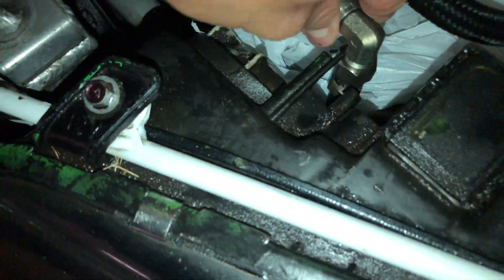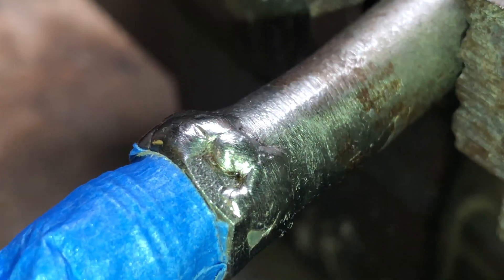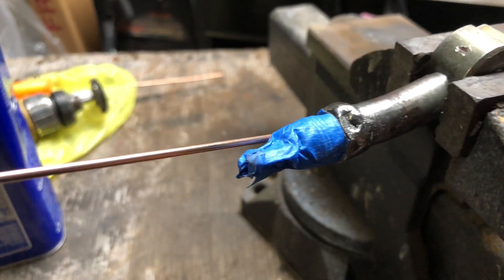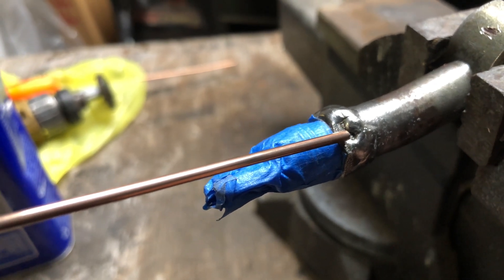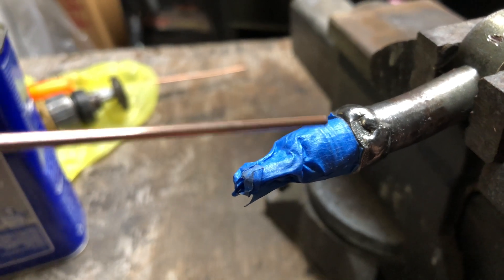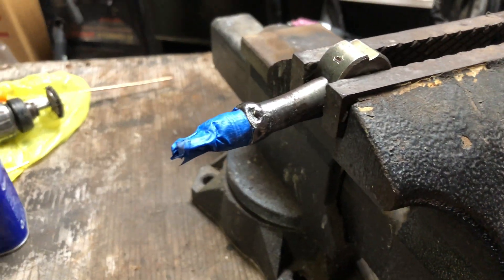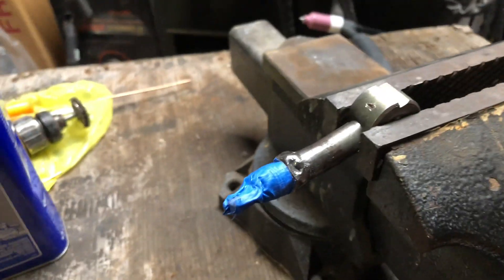All the fluid sprayed all over. I thought it was the little cooler I have. Turned on the car but nothing was leaking from the fittings. I may replace that Teflon tape with the glue I have. For this process, I'm going to TIG weld this fitting. I did find the hole — very, very tiny, right on that edge. Little tiny hole and it was bleeding out. I'm going to TIG weld it with some ER70S6 filler wire. This is for the power steering upper hose that connects to the pump.